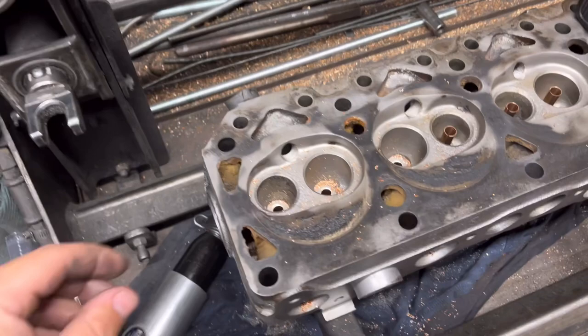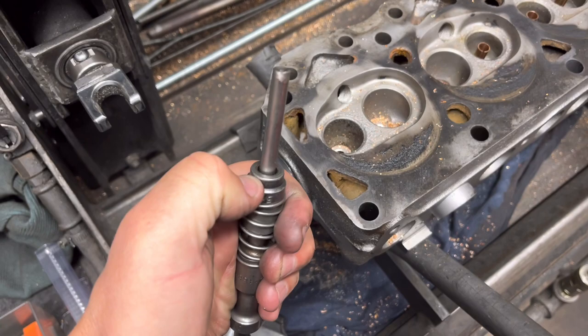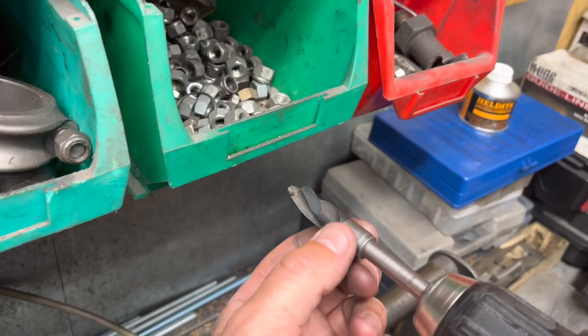When you've cut them down, you've then got to push the insert down the hole. What we use is this with an air hammer — the sleeve goes over here and sits inside that groove, and it basically just hammers it down. You feel through the other end and get to the depth you want, so you've got about the same amount sticking out the bottom. Once you've done that, we've got a cutter here with a little pilot on the end — that's roughly slightly smaller than 5/16ths — and you just top them down to the base.